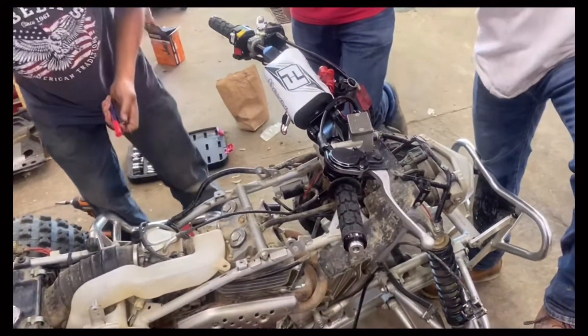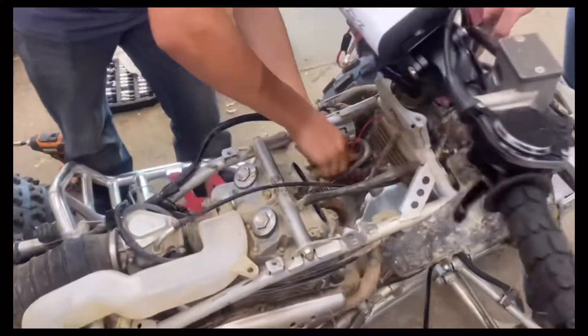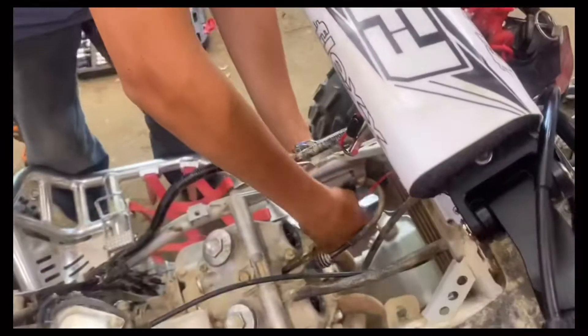So we're going to check our exhaust. The intake clearance is 0.004 and the exhaust is 0.005.